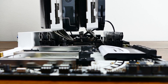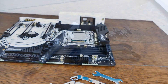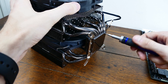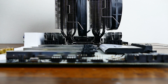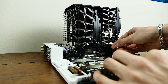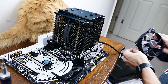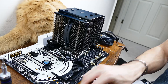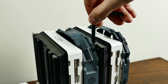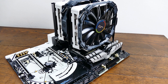Installation — another big concern for a lot of people. How difficult was it to install both of these coolers? What you're looking at right now are the parts I needed to install the Be Quiet Dark Rock Pro 3, and this is all I needed to install the Cryorig R1 — kind of get a sense of where this is going. The Dark Rock Pro 3 was a pain to install. I had to take this tiny little wrench that, at least, they included with the cooler, and weasel my way around the nuts to screw those onto the bolts to keep the cooler secure to the motherboard. I actually had to remove the front fan in order to secure the cooler — that was a pain, it took like 30 minutes. The Cryorig R1 was a much simpler process — it was beautiful. If I could take the Be Quiet's design and merge that with the Cryorig R1's easy installation process, you would have the perfect super large air cooler.